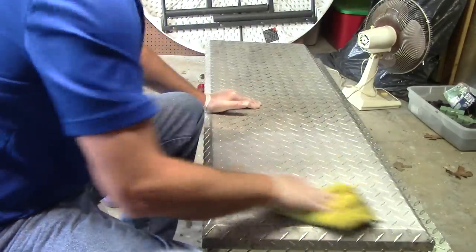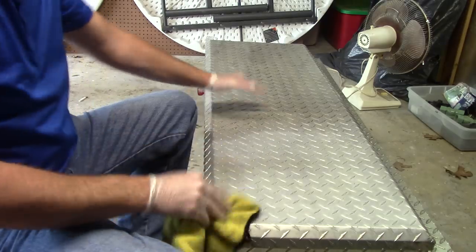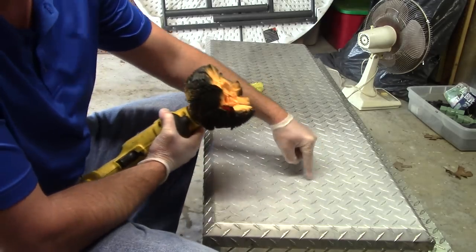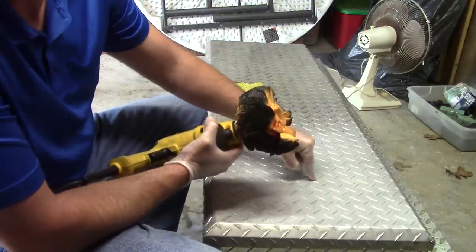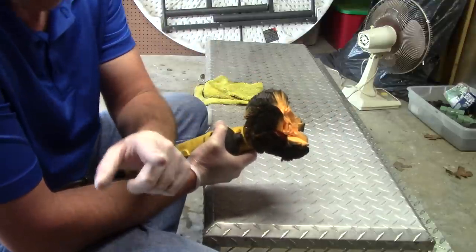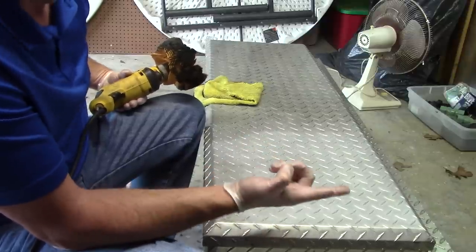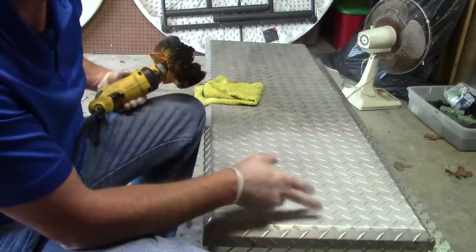When you do that on the pH scale, something interesting happens to aluminum — it actually helps you polish it and restore the finish a lot quicker. So now the aluminum top is completely clean and ready for polishing. I took advantage of the pH scale, swinging from the acid side to alkaline — remember that. I can use a rotary here with a wool pad as my number one choice, but for some of you that don't have rotaries or just use dual actions and are nervous with a rotary, I get it.